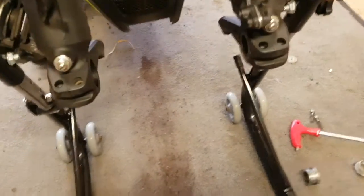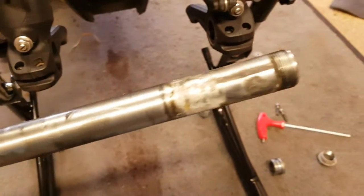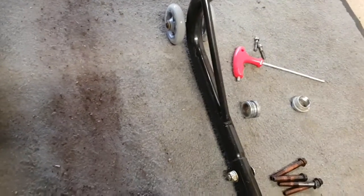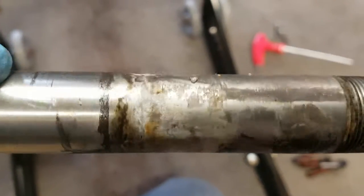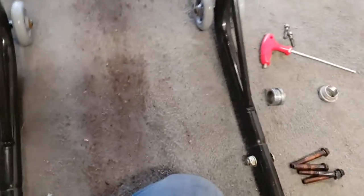When you remove the axle, and it's here, that's the left end as you look from the front. You actually need to give it a tap with a rubber or nylon mallet just to get that going. And I was just looking at that. I wonder if it's had a bit of corrosion. Oh, yeah, I think it is. Let me have a look. Yeah, corrosion on the axle there. So I'm going to need to clean that up really thoroughly as well. What was I saying? Yes.